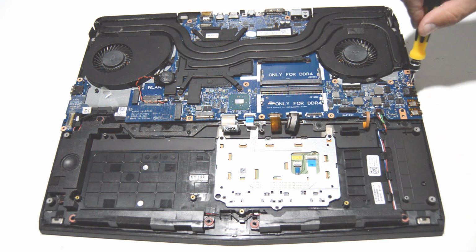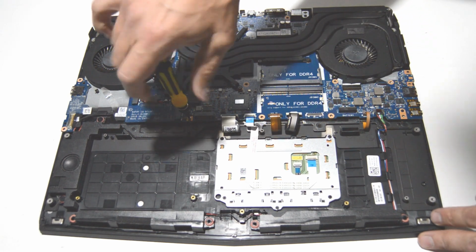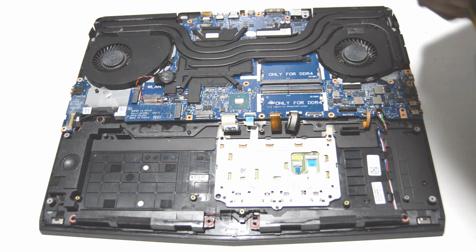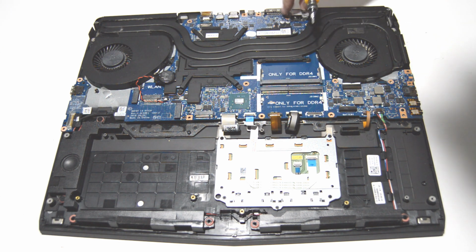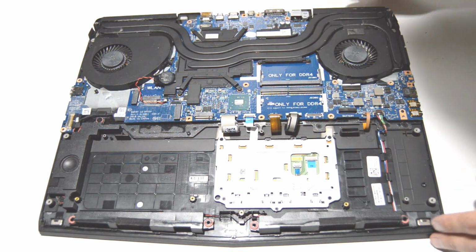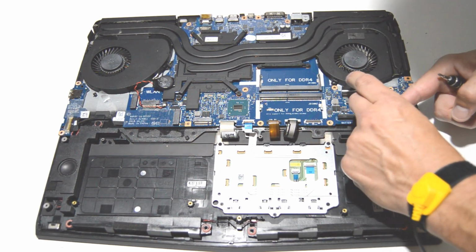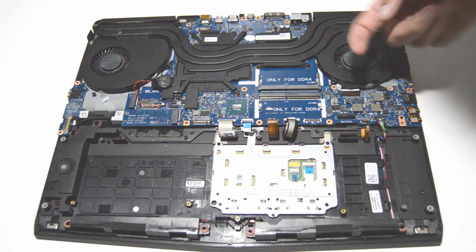And while I have the screwdriver in my hand, I'm just gonna finish removing the screws for the motherboard and we'll remove the ribbons. Loose, it should let the motherboard out. Alright, then we'll pull all these connectors on the front. This one you just lift up and release it and push it back down.